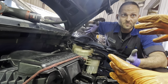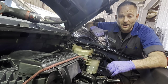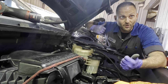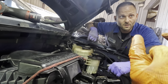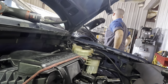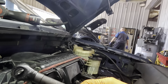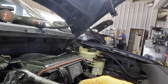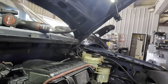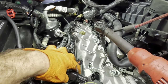Is that the one with the big, like, 6-7 inch seal in it? You got a leak at that seal, right? I would think so. If I'm pumping up the driver's side and it comes right up to 15 inches, and the other side doesn't, I think there's something wrong with the passenger side. Yeah. And they're both teed together. They're not independent from the pump either, so they share the same vacuum source. You got an issue with the hub. I'd pull the hub off, see if it's all gummed up inside, take it apart, and if that looks good, you probably got a bad seal, like it got driven in sideways. Or it's leaking air, that's what it's doing. Teamwork is dream work, folks. Teamwork is dream work, that's how it's done.